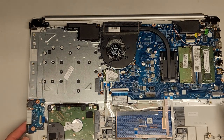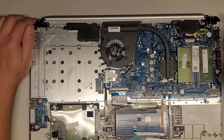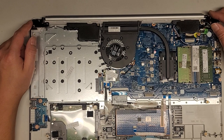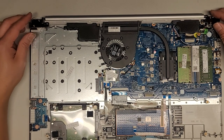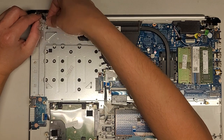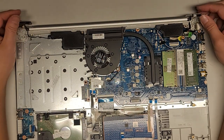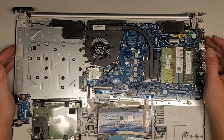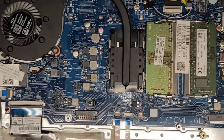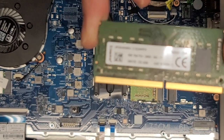I'm going to leave these hinges up slightly. If you are doing this to remove the screen, you do want to open the screen slightly, undo the screws, then close the lid so you have a little gap. I can see the broken screw mounts here. Zooming in — there are two sticks of RAM here. Pull these two tabs to the side, the RAM pops up. This is 8 gigs PC4-2666V — you can use any PC4-2666V RAM. You could go for two 16-gig sticks and have 32 gigs total.